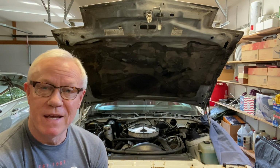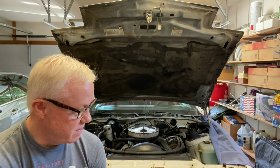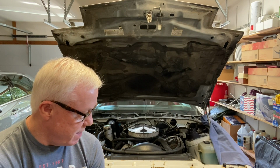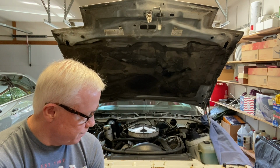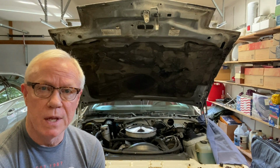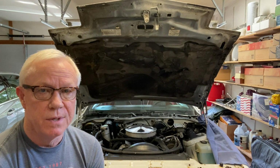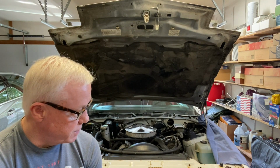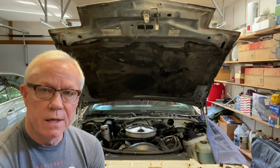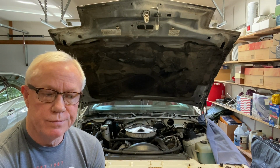And what do I get? A radiator leak. So yeah, on the driver's side, down somewhere, I don't really know where the leak is. Won't know really until I pull it out, but I do know it's not on any of the hoses. So it's just accumulating down on the radiator support and dripping down on that driver's side.